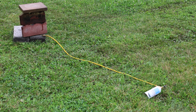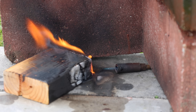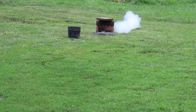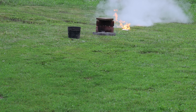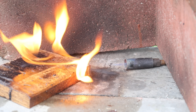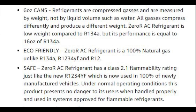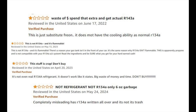I'm at a safe distance using a propane nozzle equipped with a proper check valve, pressure relief valve, and flame arrester — a very safe setup for testing flammability. The LeakSaver refrigerant is indeed flammable with a nice blue flame like you'd expect from natural gas or propane. I definitely wouldn't recommend using this type of refrigerant in your vehicle's AC system unless it's specifically designed for flammable gas. Just like the LeakSaver, the Zero-R is also some sort of natural gas with a blue flame. Probably not a good idea to use either in an AC system with a leak. In fairness to both brands, both do indicate their product is not R134 and is a natural gas replacement that's highly flammable — however, people left comments saying they purchased these products not realizing they were made of natural gas.